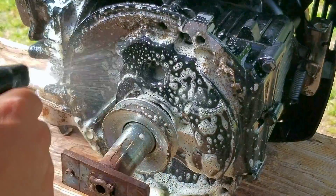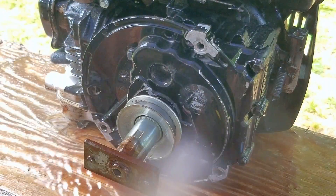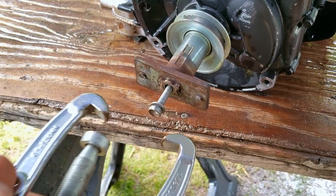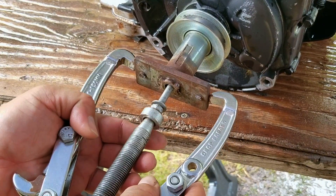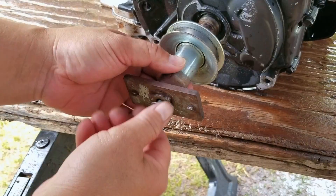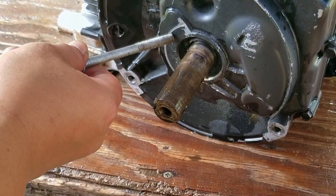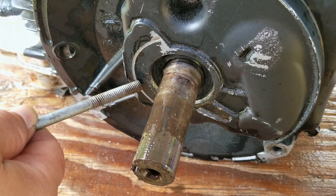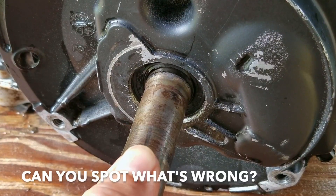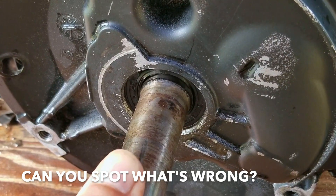Now it's time to see just how bad this crank seal really is. I'll give it a quick clean to get the best view possible. There's a possibility I might have to take the sump off the engine, so I want to make sure none of the dirt gets inside. However, things go from bad to extremely bad pretty quickly. The stock bolt is now too short, so I had to use a longer bolt to get enough travel to remove the adapter off the crank. After getting the adapter off the crankshaft, I noticed the top edge of the pulley appears to have made contact with the sump — something that should not even be possible. The only way this could happen is if the crank had too much play in it, which is not a good thing. At this point I'm not even worried about the crank seal leaking — I'm worried about the crankshaft itself.